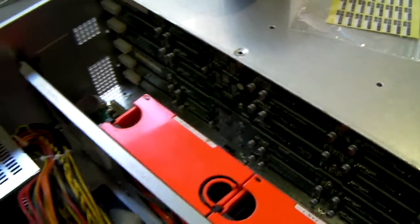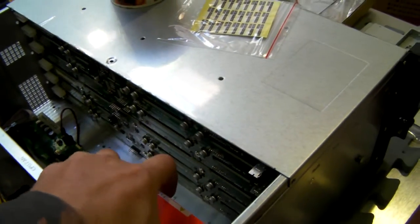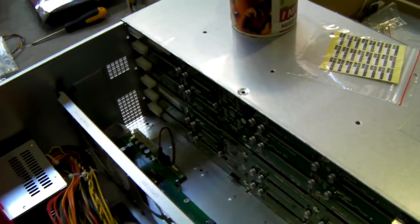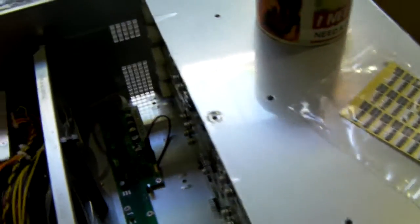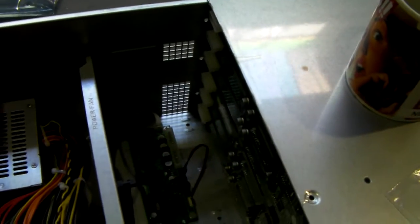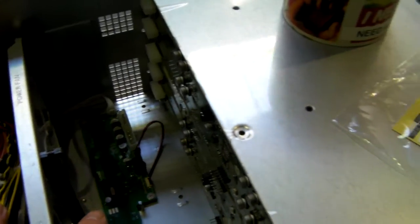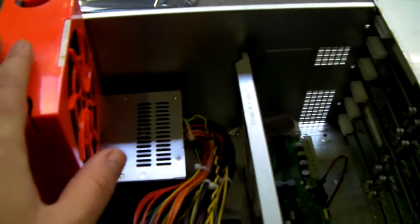One of the beauties of this setup is that you can make this quite a low noise solution, but there are some problems depending on what motherboard you use to do this — especially with Supermicro ones — where the fans are controlled not through the BIOS but through IPMI. Sometimes the fans will go to such a low point they'll actually set off a warning.